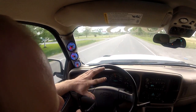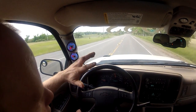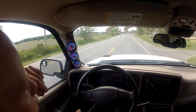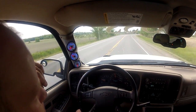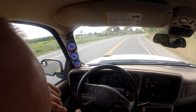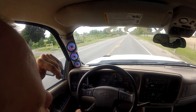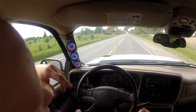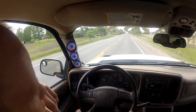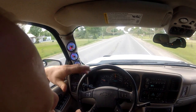At 85–90 kilometers an hour I'm doing about 1,780–1,800 RPM. The transmission temp is around 140 so that's pretty decent. The exhaust temp is fine, but we're not running any boost yet so I imagine that won't go up. I'm really happy with the sound inside — it's not that loud. I need to clean it yet and do an alignment. The steering wheel shakes a little bit; I put different chrome tires on and they're vibrating a bit, and I've got a little tire rub hitting the mud flap on the wheel well.